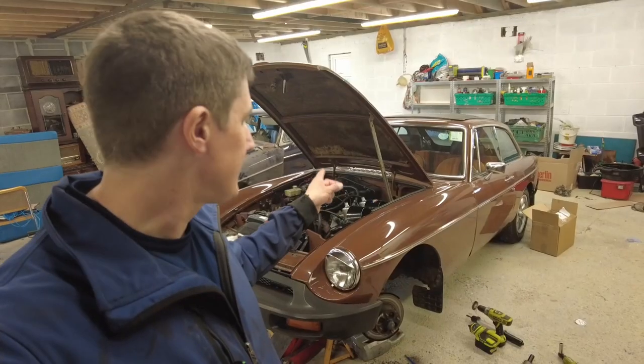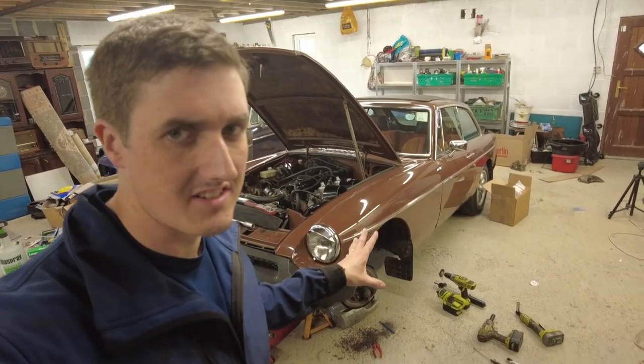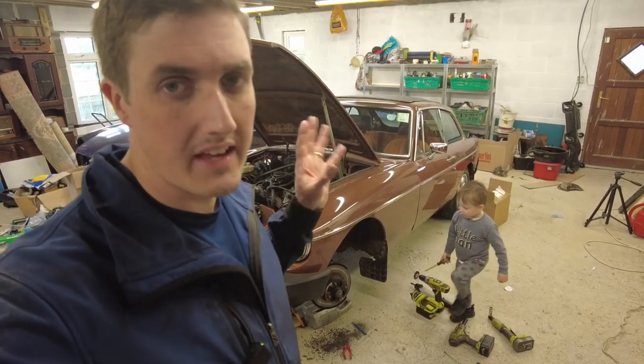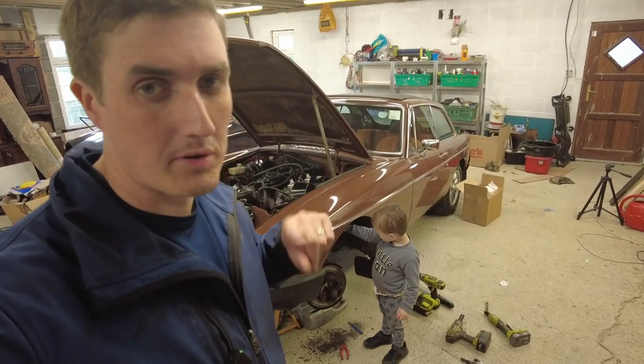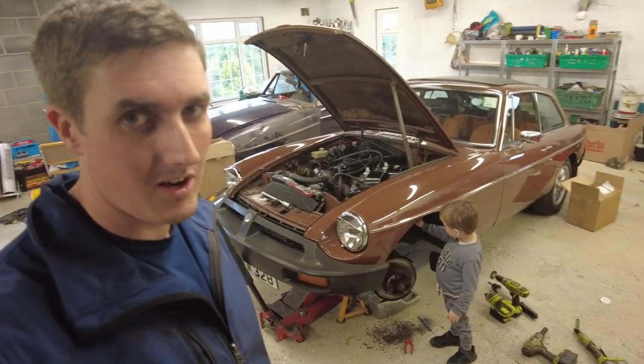Here's the new slave cylinder alongside the old one for any doubting Thomases out there - I am replacing them. I also got the new brake line. I'm not going to film all of this - the slave cylinders are just held in with a little circlip, and it comes with a new circlip. The back brakes are now complete - new slave cylinders installed, handbrake cable all greased up, everything adjusted, and the new flexi line fitted. Now on to the front - that's a whole other ball game.